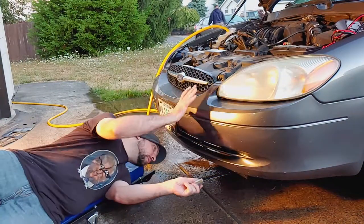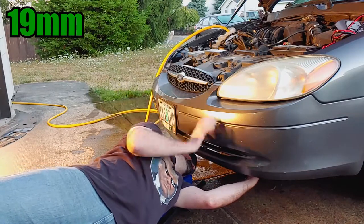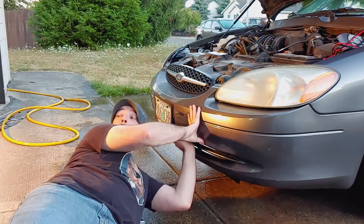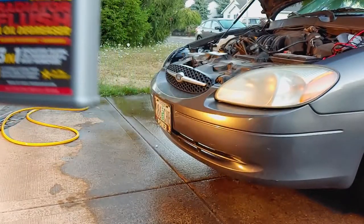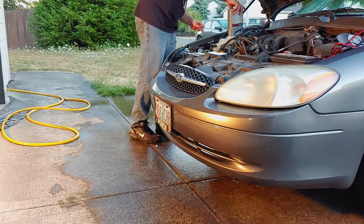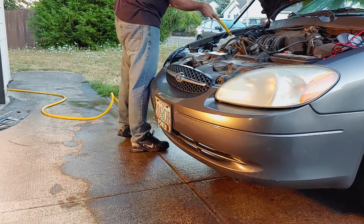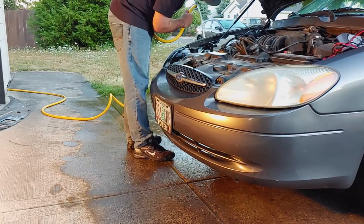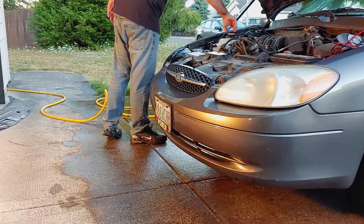Shut off the engine and let it cool down before you drain the water out, but don't let the cooling system drop below freezing when it's filled with water. Put the drain plug back in the radiator and pour the entire bottle of radiator flush solution into the reservoir. This time, fill the system with fresh water up to the full mark on the reservoir and put the cap back on. The directions say to let the engine run like this for 20 minutes with the heater on max. They also say you can drive the car like this for 1 to 2 hours for a deeper cleaning.